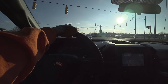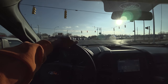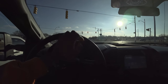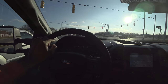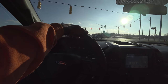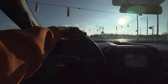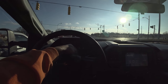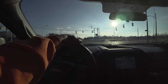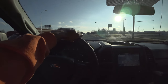The 4.30s give you all the takeoff power you need and make the truck feel faster, but it feels more car-like and less truck-like as far as gearing is concerned. Cruising at 80 miles per hour you're at about 2,500 RPM — not terribly high — but at 30-35 maybe 40 miles per hour you're going to use all your gears, all the way into sixth and overdrive just by going about 45 miles per hour.